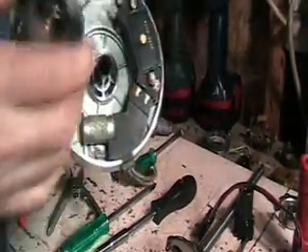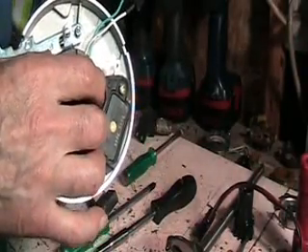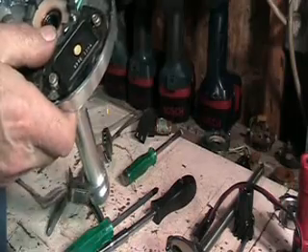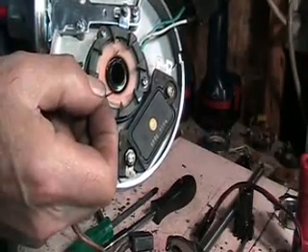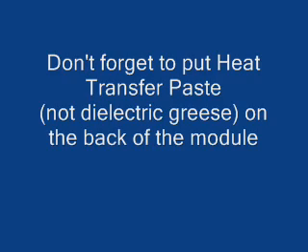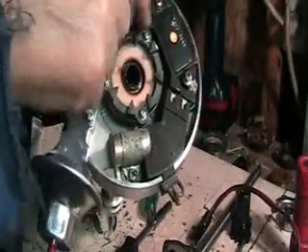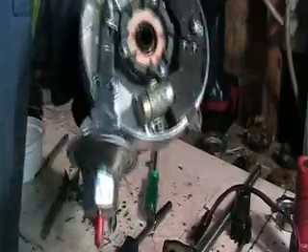Now I've got this all in here — I didn't quite tighten everything — but now I'm going to put this pickup coil in. You've got to match it up here with this advance. I'm going to make sure that goes in there. Now this tiny little clip here goes in a little groove here to hold the pickup coil in there. I put this in, tighten all the screws. I made sure this resistor here is nice and grounded down there. Tighten all these screws up, and it should be good to go now.